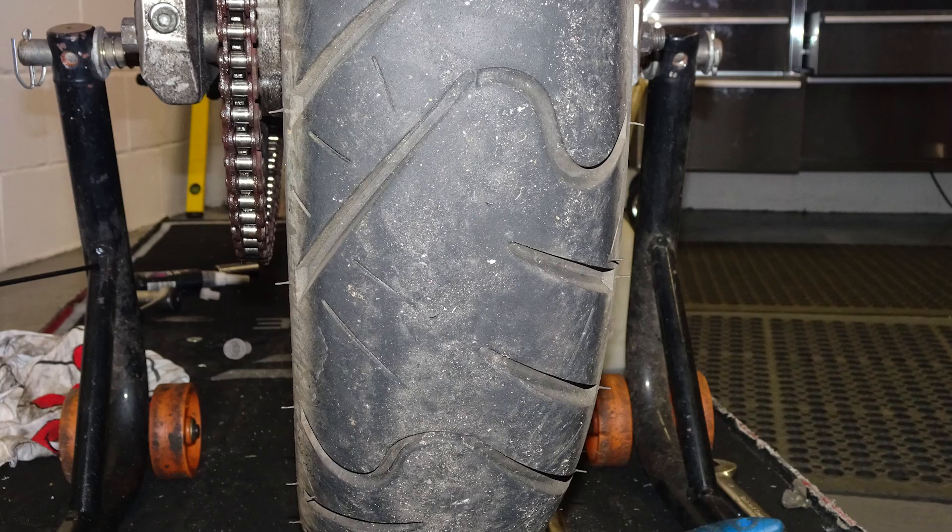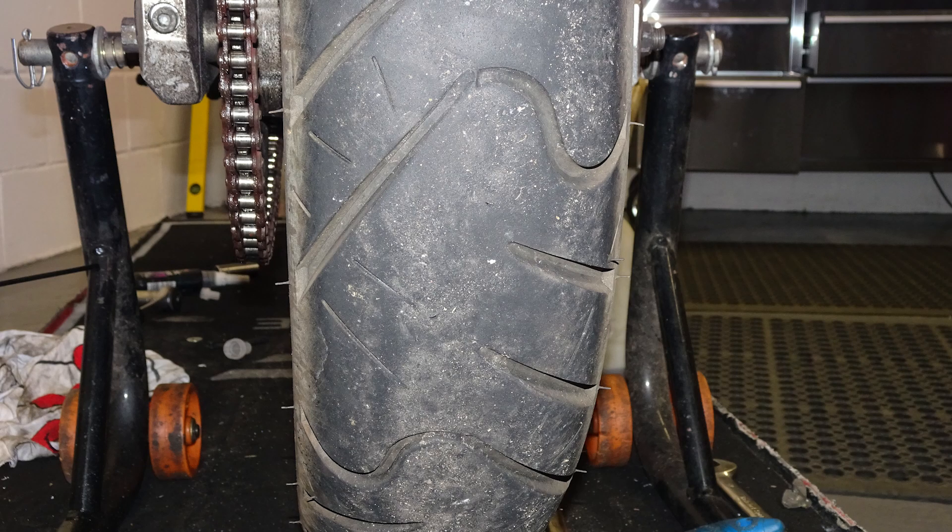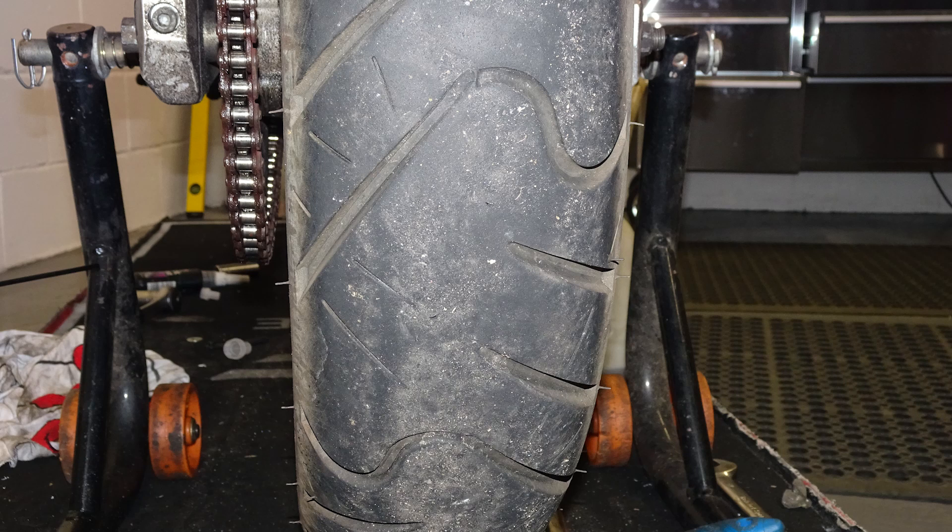If you look at the rear tyre compared to the front tyre, you're going to see that the rear tyre is now at the legal limit — it needs to be changed. This means that the person who's been riding the bike has been using that accelerator quite hard and maybe doing a couple of wheel spins. This tyre is worn completely around the centre of the wheel and not a lot around the sides, so that means they're a little bit wary about leaning over from side to side when going around corners. When they're riding, they're going to be upright and not turning correctly.